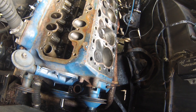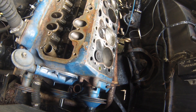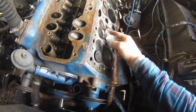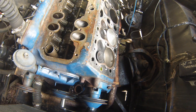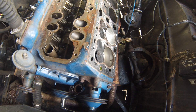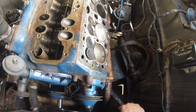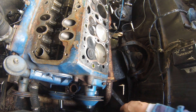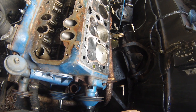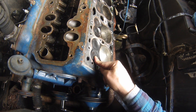There's a firing stroke — there goes the exhaust valve starting to open up, pushing the exhaust valve up crooked. And this one's wet, and I'm thinking the ring is in bad shape. I don't know if I can get the pan off in the car — I might just have to live with a little smoke. Number six doesn't look too severe, but number five has definitely got a bent exhaust valve, definitely.